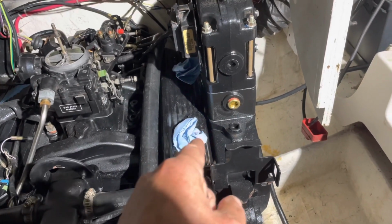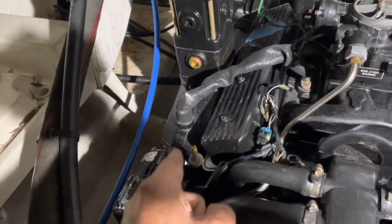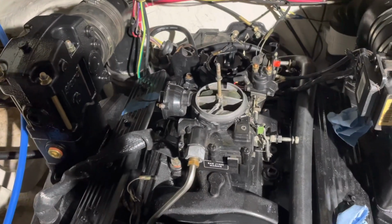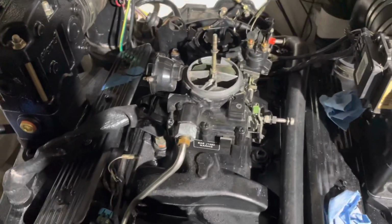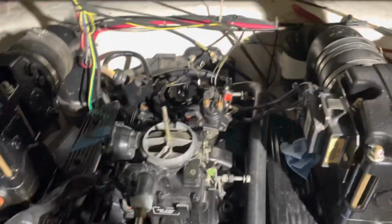It's 1, the odd cylinders on this side: 1, 3, 5, 7. Over here it's 2, 4, 6, 8. So like I said, you follow the spark plug cap and the wiring in the order I just mentioned, and you run the spark plug wires to the appropriate number cylinder, and then you hook them up. Then you screw the cap down, and the distributor will be installed.